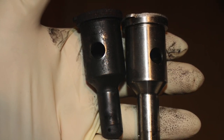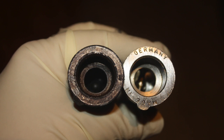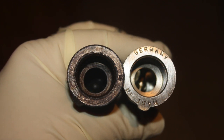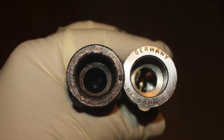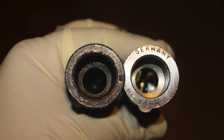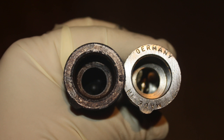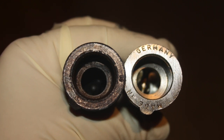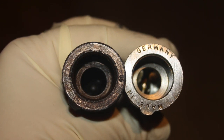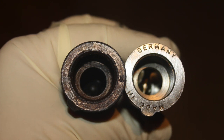Here is a comparison of old versus new. On the right side you'll see the new chamber with the little ball firmly and rigidly installed. On the left is the old used one. On old ones they tend to disintegrate and wear, and then the spray pattern is disturbed and combustion isn't really clean. The engine doesn't run as well, and in the worst case scenario you lose that ball and the fuel injection goes straight down into the cylinder and can wreak havoc.